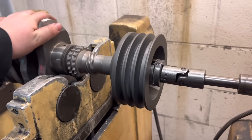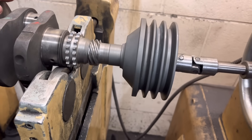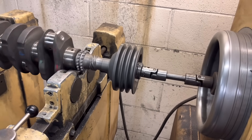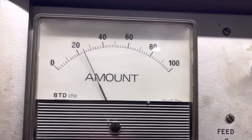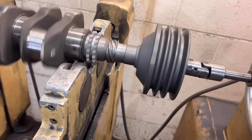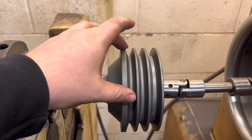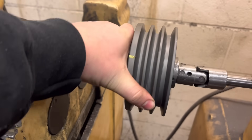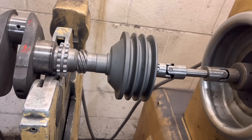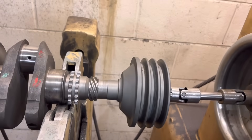You can see we've got the front pulley on there, which I think is new — looks quite nice. I don't know whether Paul's just blasted it and it's come up well. We're on the right-hand side and it's gone up to about 25, which is not too bad. What I do is find the angle and then you can usually get a four-mil drill in there, or if you have to, take a bit out the back. Sometimes you get front pulleys where there's just no way you can drill, but these are all good — you can get a little drill in there.